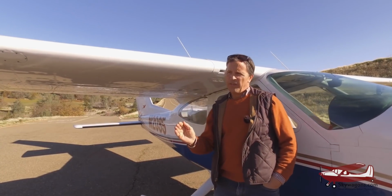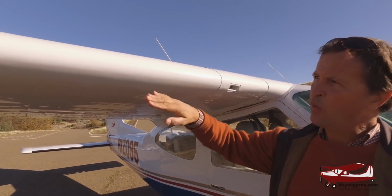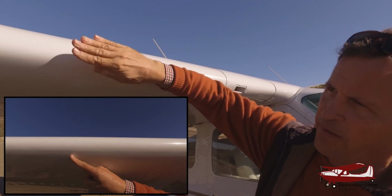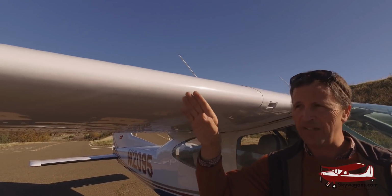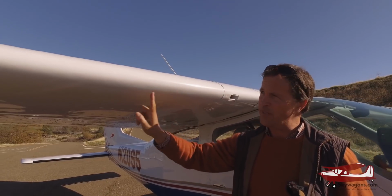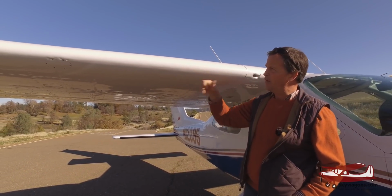A very little known tidbit of information that Keith Peterson from the Cardinal Flyers told me: on the early planes, the ones that had the stalling issues at low airspeeds, when they form this wing they obviously fold it, and you can see a flat area where the wing has gone, and if it's perfect, it's smooth. And the earlier planes that still have these ridges on them actually flew slower, and they didn't have as much of an issue. It's not a scientific thing, but he's a mechanical engineer, and he said it's been noted that the ones that have that fly more slowly. So it's a marginal stall thing, but I just saw it with the sunlight on it the way it is at the moment. I hadn't ever noticed it before, but you can see that on this plane, which is a 76.